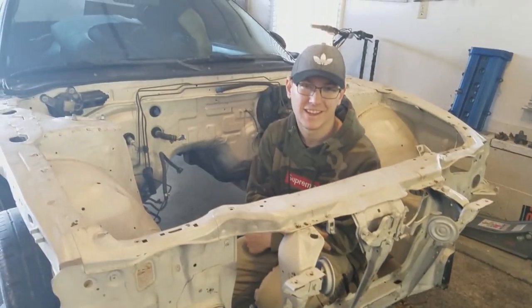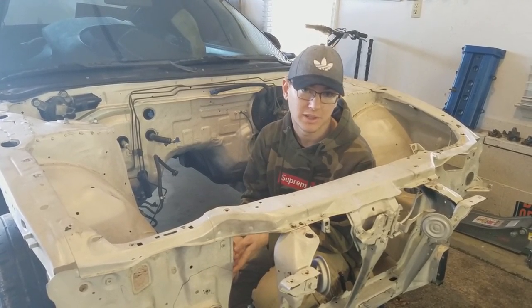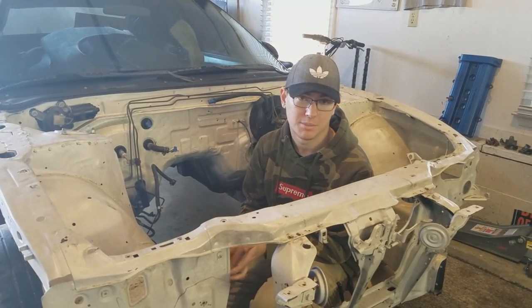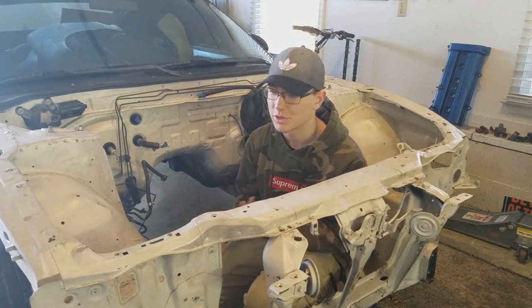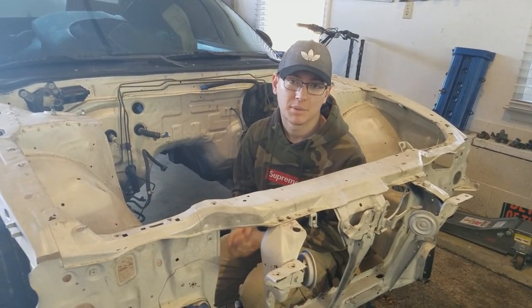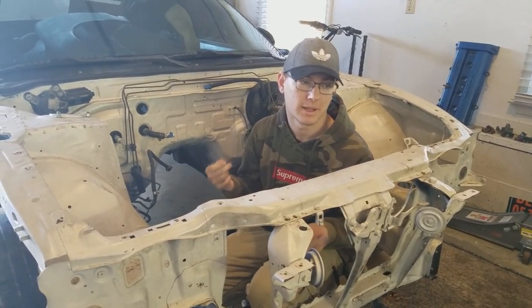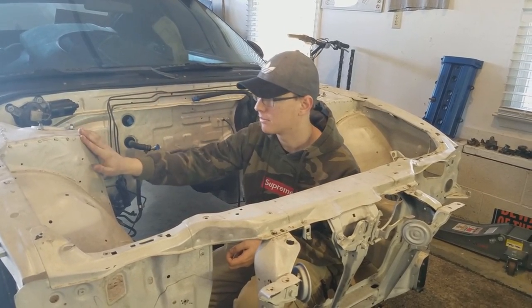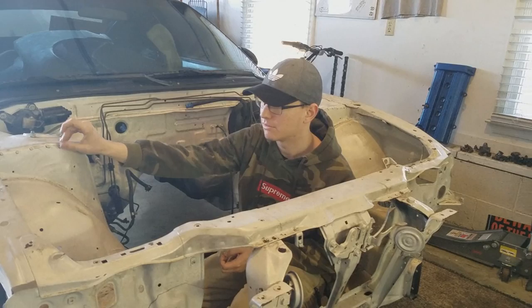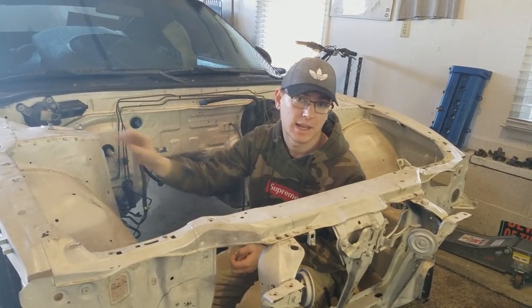In the near future for this car: I plan on putting the brakes back on because there's no brakes on it. I plan on undercoating it, putting the interior back in — I don't know why he took it apart honestly. Paint the fuel tank, put the fuel tank back in, weld the diff before putting it back in so I don't have to take it out again. Prep the engine bay for painting — grind down the boogers with a flap wheel, sand it all for paint. Then find the KA and get ready to swap it in.